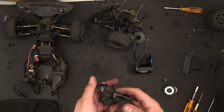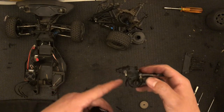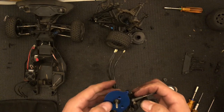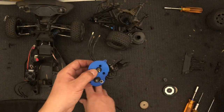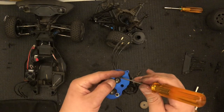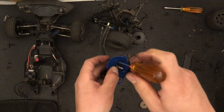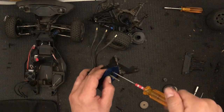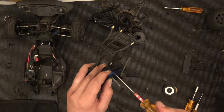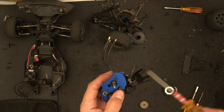At this point I can go ahead and install the motor plate. Notice these two holes are closer together and that one's farther away — closer together, farther away. This will simply go here. If you do not remove the motor and you're putting the same gears on the same size, you don't have to deal with the mesh. So I'm going to get this one close, not driving it all the way in.